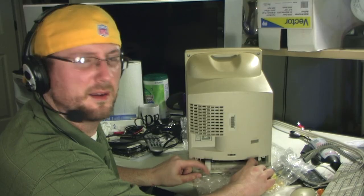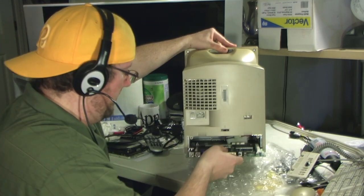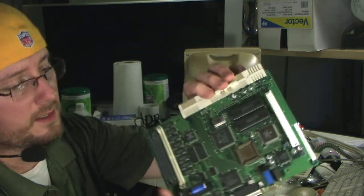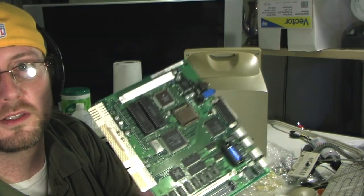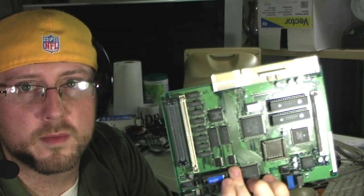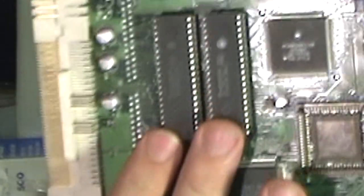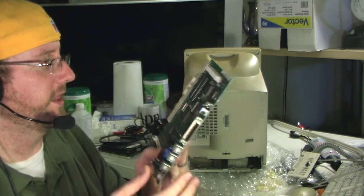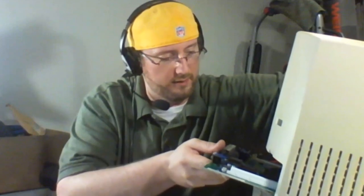You've got these little tabs back here. There are actually a few YouTube videos on this. The logic board slides out — here's the logic board. The silver things are the capacitors. A toothbrush and rubbing alcohol pretty much takes care of that problem. I also took the EEPROM chips off very gently to make sure I didn't bend anything. I cleaned those and let it dry overnight, then put it back in.